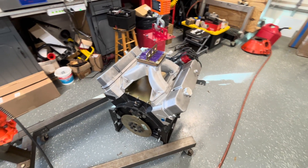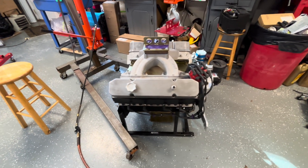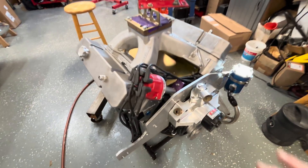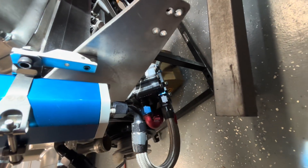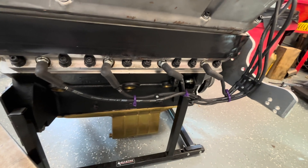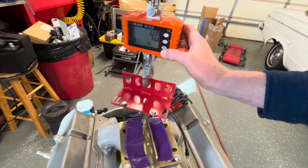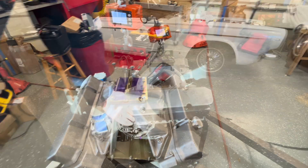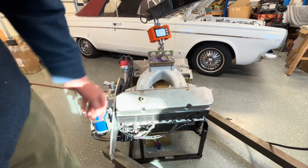Here's probably why you're actually watching the video. This is our 580, or 78 stroker, that I'm going to dyno soon. It does have the front plate on it, aluminum water pump, external oil single line — a little bit different than stuff I've done before, but you've got to have that with this block. I'm not sure what the block is — it said BD N50, so maybe that's a Bulldog. I'll have to research that a little more. I've got an engine plate hanging on here with bolts in it — I can tare that, hook back up, and see what she weighs. Also notice this is on a cradle, so I'm going to have to pop that cradle loose to get it free floating.